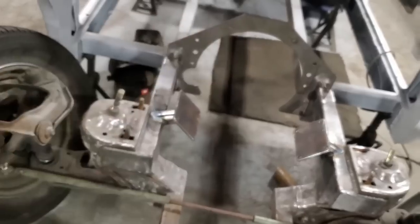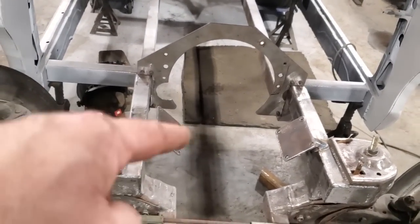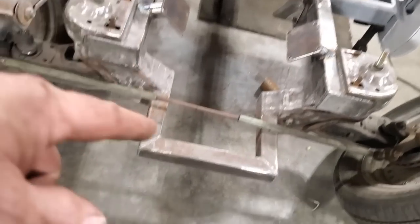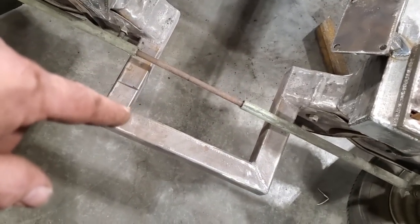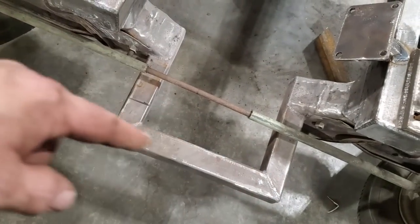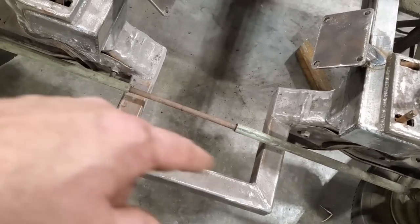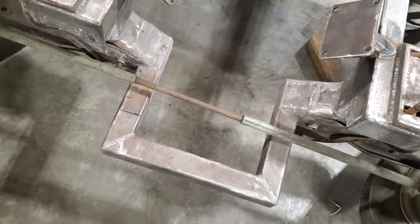So I'll slide it in, play with it, and lay it in place there and see how hard it is to put in there. But before I go at that, because when I put the motor back in I got to do the transmission, the mount, and all that, I'll just leave it in there. I'm going to straighten this up front here. You can see where I marked this here. That there is supposed to be the corner now. So I'm going to go ahead and cut a new piece here. I got to put another piece of steel there. Cut that on a 45, cut that on a 45, and then put a new cross member across there so I can move that back, and that'll move the rack back, and I'll have that done then.